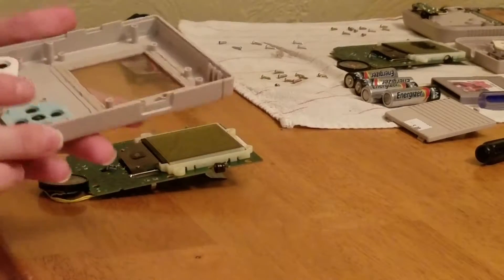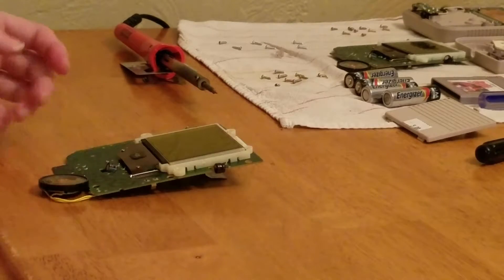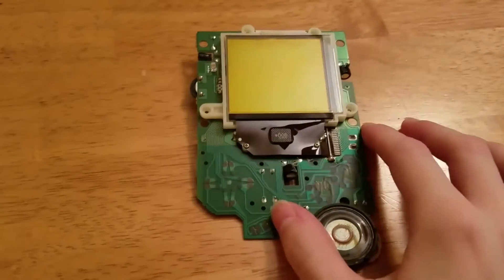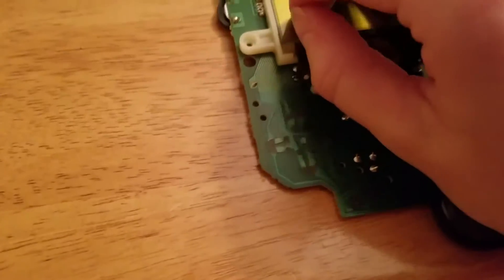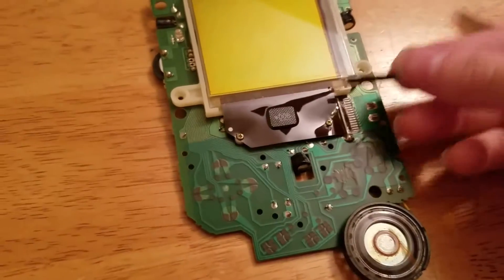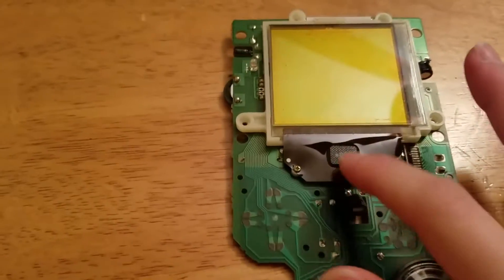If you want to clean these pieces, go ahead, because these are really dirty — I don't know where it's been sitting, but it's been sitting somewhere black and gritty. Now we are at the main front half of the motherboard. You're going to want to take off this black piece here and be careful with it. I'm not going to throw this out because it looks like the adhesive did not come off with it. I may have to stick it on with another piece — we don't want the soldering iron going on top of the adhesive.